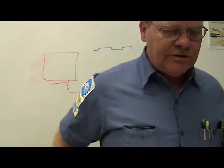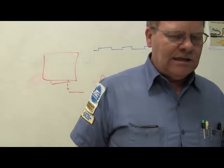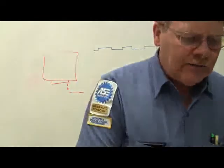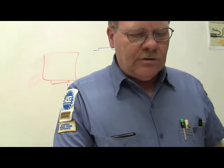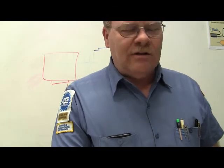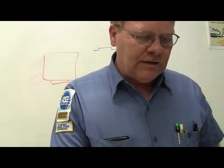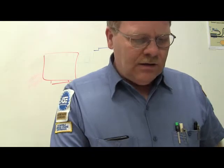2, 3, 5. Number 2, how has the rear carrier in the 41TE transaxle been upgraded? C. Carrier's got 5 pinion gears. Of course, I remember, Daniel, I could see how you got confused, because weld thickness had been doubled on that other part. Remanufactured pumps can be used as replacement parts on new or unsold vehicles. That is absolutely false. A new vehicle gets a new part. If it's a new vehicle that hadn't been sold, if it's still on the showroom floor, but we're not dealing with that here. Set the torque converter break-in adjustment after replacing the... you know about that one.